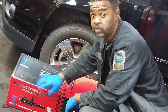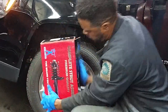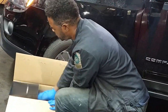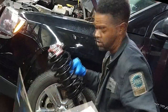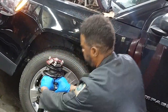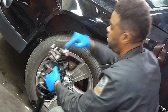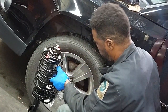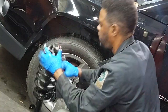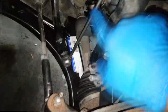What I have here is a one-piece strut assembly. This cuts out a lot of work and also a safety issue — I don't have to compress the spring or fool with a spring compressor. This is a hack I employed a while ago. I refuse to get burnt twice. I remember one time putting in hub bearings and a lower control arm just to find out the noise was coming from the strut.